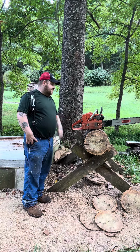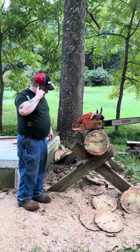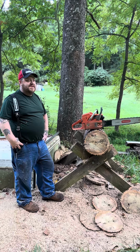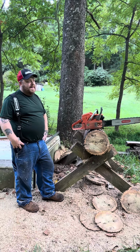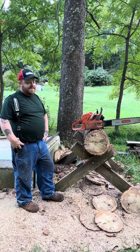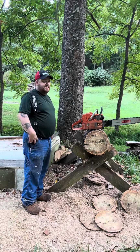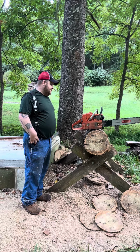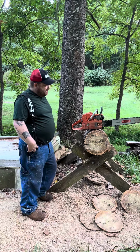Got a new fuel filter on it. Fuel line was good. I had to put a new spool in the recoil. I don't know if it was just the original and wore out. It said Brazil on it, so it wasn't an original one. But it didn't say Husqvarna on it. It was either a really good copy, or it had been on there a while and it was just used up. It wouldn't catch the dogs. So I got a brand new OEM. It says Husqvarna right on it. And it also says Brazil, but it's OEM stuff. So it's mostly OEM, some aftermarket goodies.